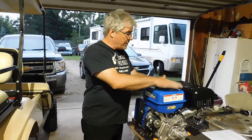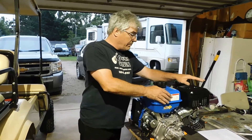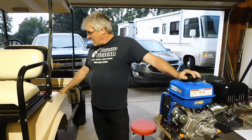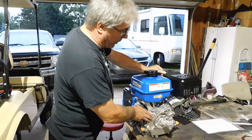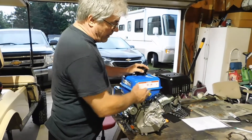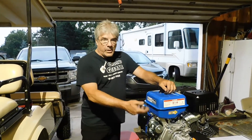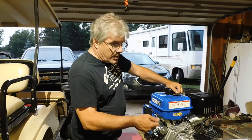It should clear the seat, but it's not ideal because one, the gas tank is small, and the exhaust is right underneath your butt, so the passenger is going to get a little hot-butted. It's better to use the gas tank that's in the golf cart, but in order to do so we have to put a vacuum pulse somewhere in the engine to run the fuel pump.